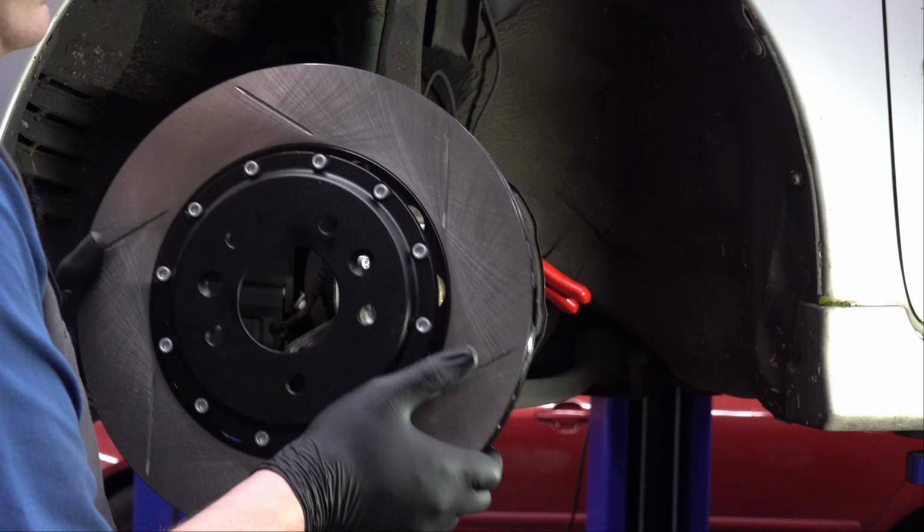It slides on these sliders over here, which tend to get gummed up and make it so that the brakes don't slide as easily as they should, so you get kind of uneven braking force. Plus, the way that this caliper works is that all of the input comes from this side.